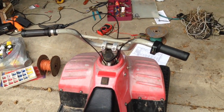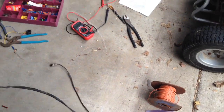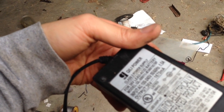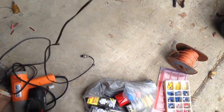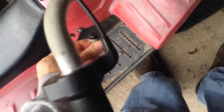I'm going to plug it in and let it charge, and it'll be good and charged up when he gets back. The charger I had — I bought a little scooter thing, three-wheel, kind of looks like a Segway. I bought it for $10 or $20 at a garage sale. I had to put batteries in it. The kids rode it for a while but they weren't too crazy about it. But it's 36 volt, so I'm using the charger from it. The plug's the same and the pin-out's the same, so without modifying the charger I was able to have a charger that would work for this.